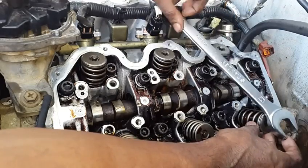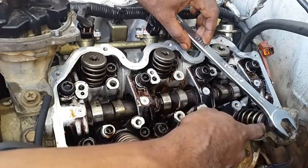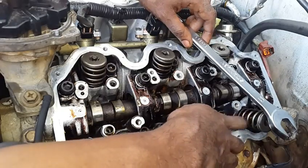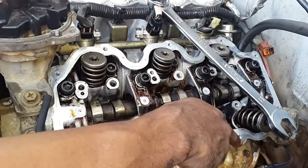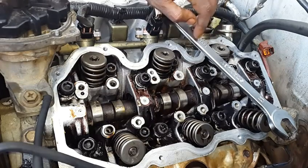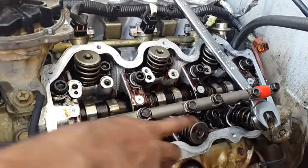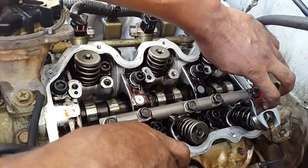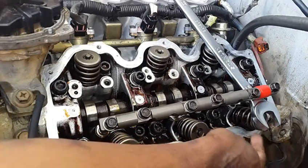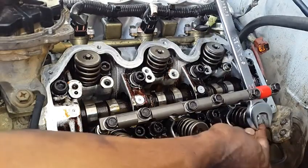This we might find a little challenging, but we have to assemble everything back together with this wrench on top of the retainer. Now when we compress this spring we want to make sure we don't bend the valve stem, so this is going to require a lot of skill. If you're skillful enough you could practically replace all the valve stem seals with this method. I've been adjusting the wrench so the edge of the retainer sits right on the underside of the wrench, because when I compress the wrench I don't want it to hit the valve stem.